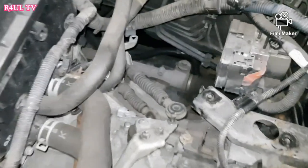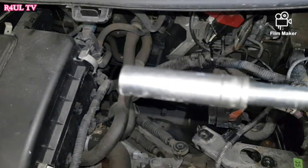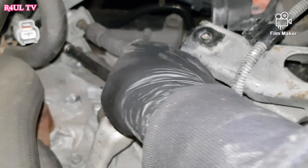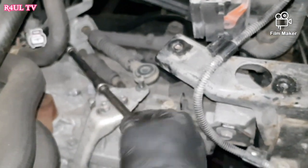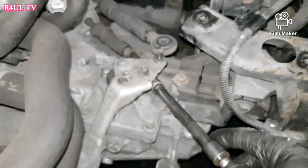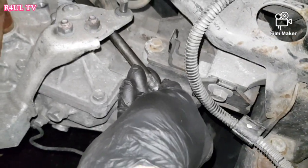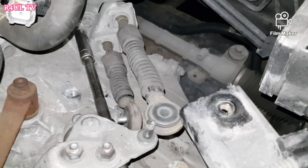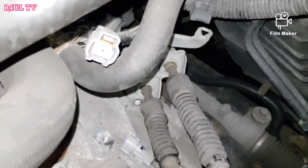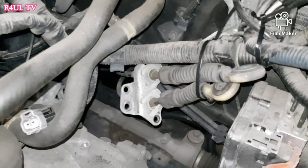For those who want to know how to take them off — you can't really get a spanner in there, so you need a long extension with a 12 milli socket to reach it. I've already cracked them with a ratchet. Take the first one off like that, come round underneath the linkage housing for the bottom one, straight in there — same with the bottom one. That's the way you take all three bolts off. The linkage bracket is off.